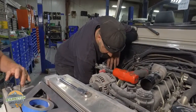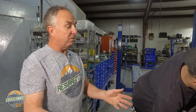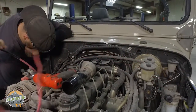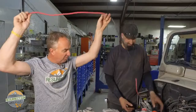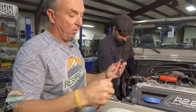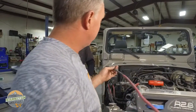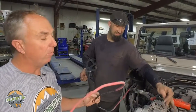Where is another place you've seen recently where somebody put a battery where it shouldn't be? In the bed. An FJ45 pickup we recently got in here has the battery in the bed. It just doesn't make sense to put the battery far away from the things that need power — especially the starter, which needs the most power. The big problem is the routing of a big cable through precarious situations, wrapped in thin electrical tape. The longer your battery cable, the more chances you have to rub through it somewhere and create potentially a humongous electrical fire. There's almost always room in the engine compartment. Stop it!